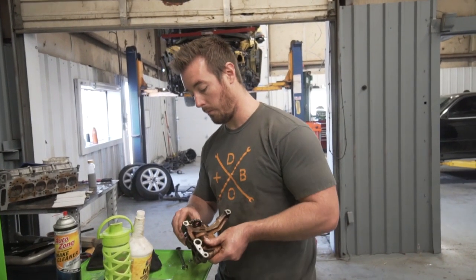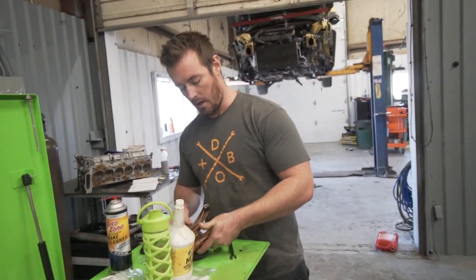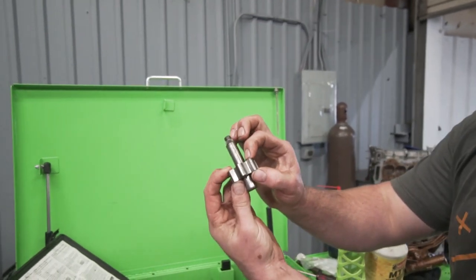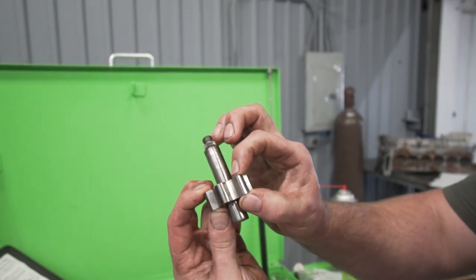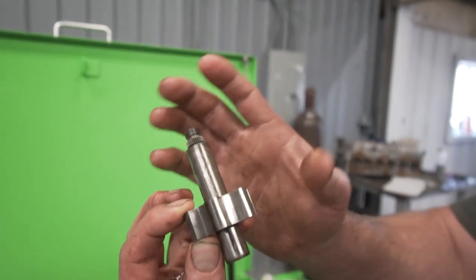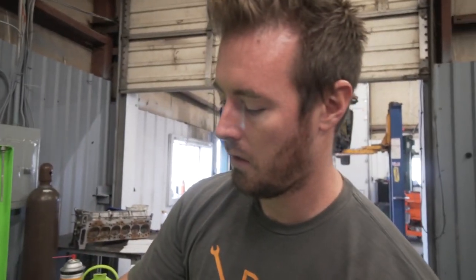And that's actually, if you guys are building a high performance motor, an S54 oil pump machined to the proper depth. So the depth on the S54 is about the same as the M50, but it spins at higher speeds. So if you machine that extra 10 or 15% at the higher speeds, you're looking at about, I think, 20% increased oil flow. So if you're building a high performance motor, recommend you find yourself an S54 oil pump core and have it machined deeper.